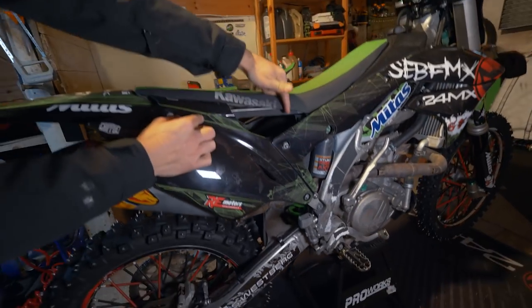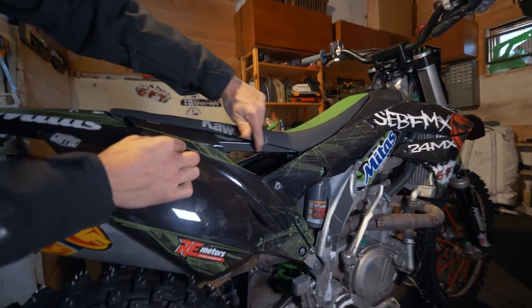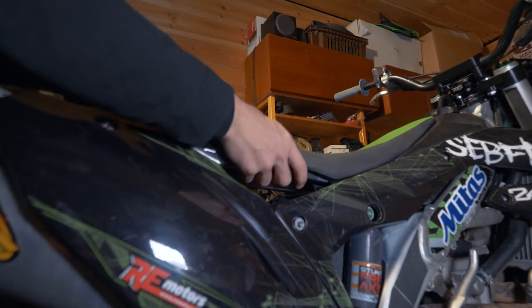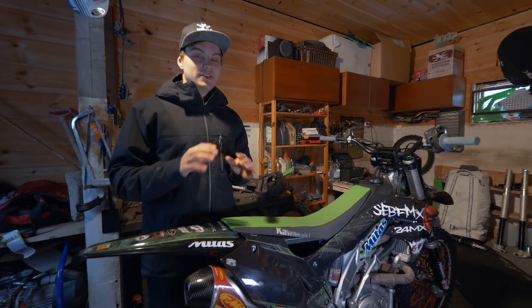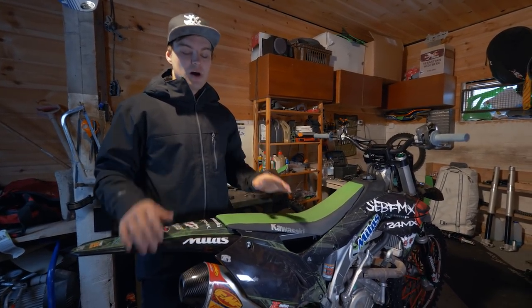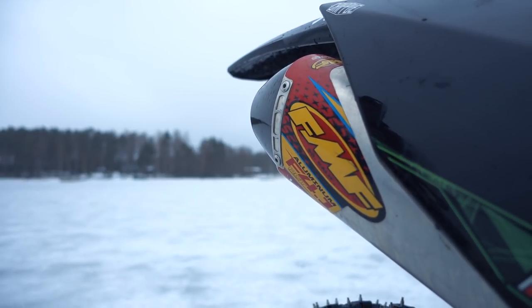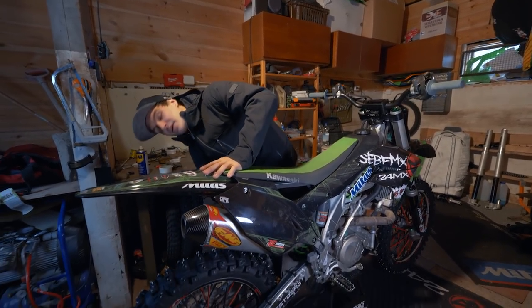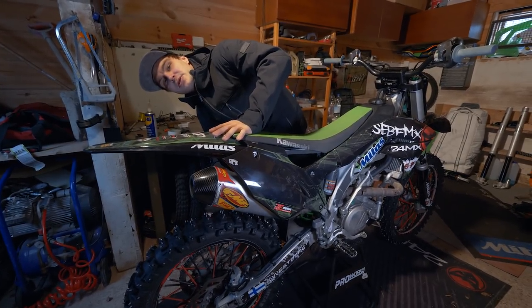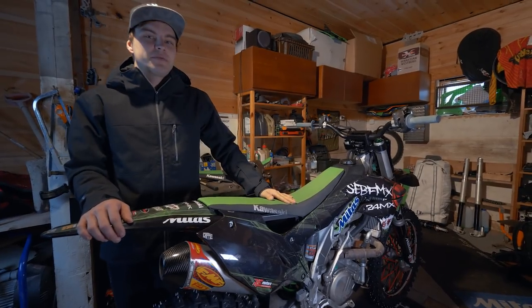For having a good grip, I put grip tape on — it's the same cover used in skateboards, so your hands don't slip when it's wet. The engine is totally normal, it's a stock one, but I run an FMF slip-on exhaust pipe because it gives a little bit more power on the ramp. I also changed to a 52 sprocket — the stock one is 50, so it's just two teeth bigger. But that's actually everything.